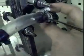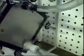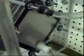Alright, now the issue of the positioning of the plates. I've found most people make their dry cells sitting rectangular or square like that. And what I found was that when the water level comes down, there's a big column of stainless steel plate that is not flooded at that moment. By taking the plates and just twisting them into a diamond shape like this, that allows the most amount of water to cover the plates, keeping the amperage up and the production up. Scarecrow said he never got much production difference doing it like this, but for some reason I did. Maybe it was just the way this cell was built, but using a diamond shape got me a little better production, and it always kept the amperage constant, and it kept the plates flooded all the time.